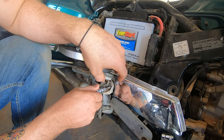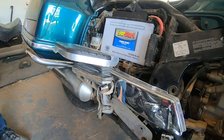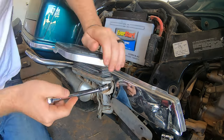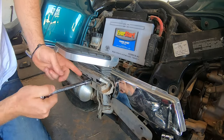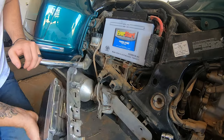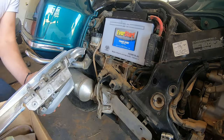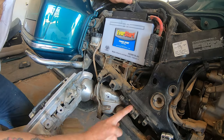Now with the bottom cover off using the Phillips screws, you can get to the Allen head bolts — I believe it's a 7 or 8 millimeter. And if you didn't know before, you can tell now this bike lived in a desert. There's quite a bit of sand that just fell out of there. With the footrest removed, you can get to the heat shields and there's the master cylinder.